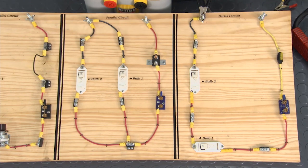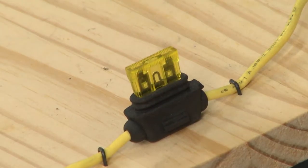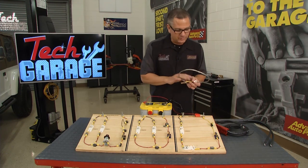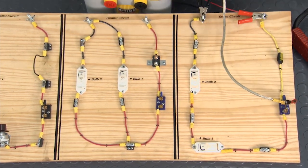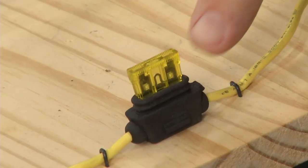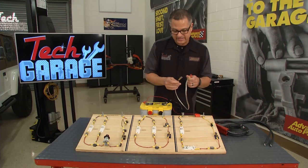I've got some circuits laid right here on the board so you can actually see. This one here is a fuse-protected circuit. What I'm going to do is hook it up. Any time you have a short circuit — which could happen with your winch — the amps are going to bypass the actual circuit and run so fast it's going to blow this fuse right here. If we watch this fuse and I touch this instantaneously, that's going to pop. That's good — that's the weakest link. That's not going to burn the actual circuit itself.